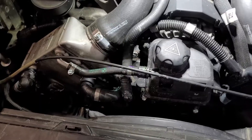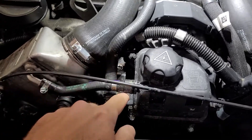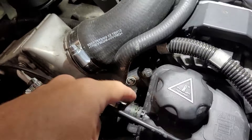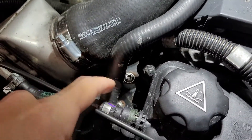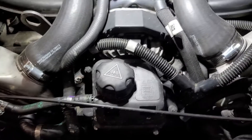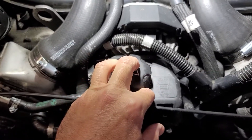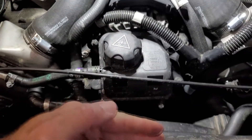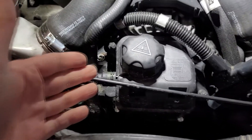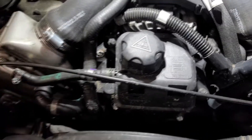Once you have access to all that, the pump is actually right under here where these two screws are — that's what holds the pump onto the bracket. What I'm going to try to do is just move this coolant reservoir and lean it back against the radiator to see if that gets us enough access to the bolts without taking a whole bunch of stuff off.